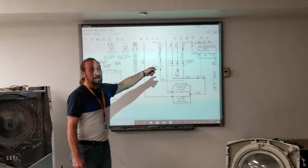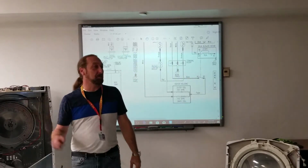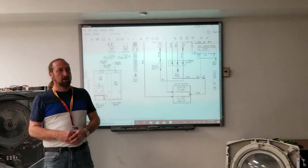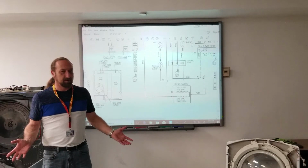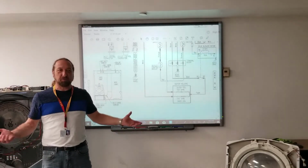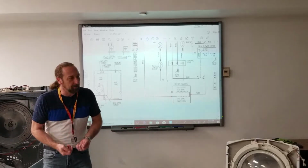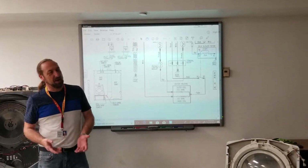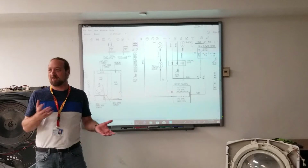Ma'am, I need to get you that thermostat. They go get the thermostat, come back, and change it, and it doesn't fix it this time. And they're like, I don't know what to do. Yeah, I've changed it 100 times, and it fixes the problem. Have you ever taken a meter out and made a few tests? Five or ten minutes of testing saves you a lot of time and work.